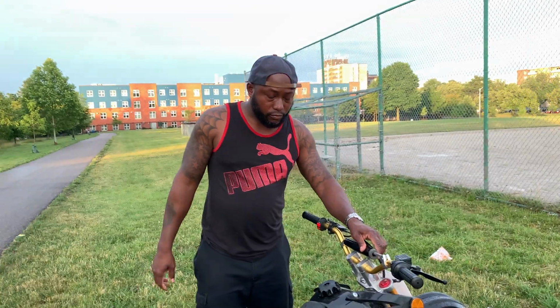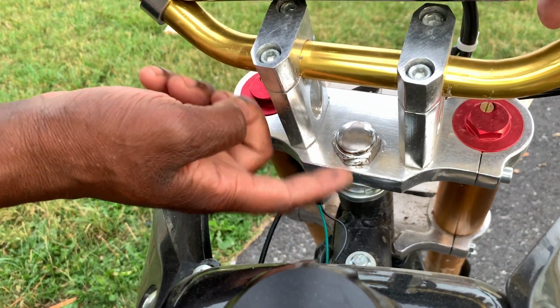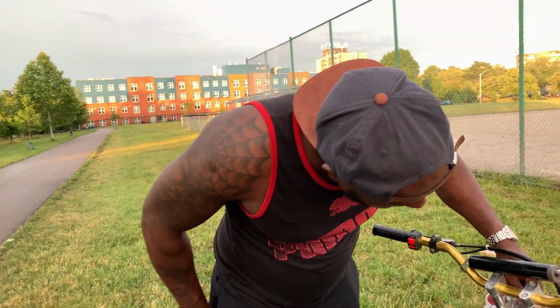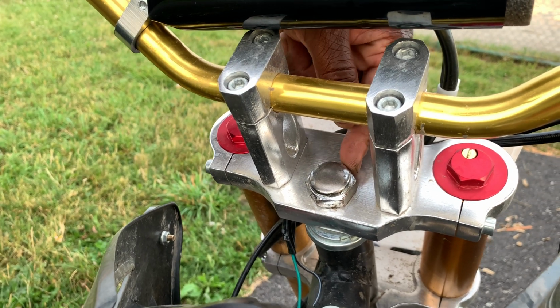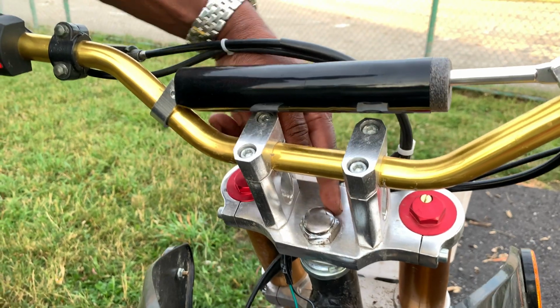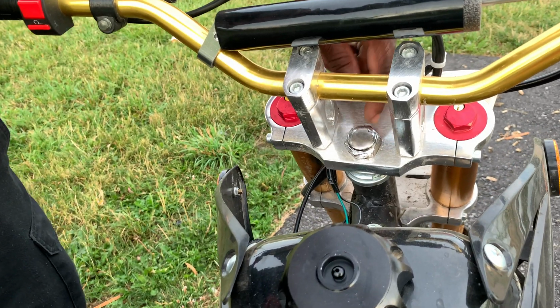So first, you have to put Loctite on this guy. You have to take this one off and put Loctite on that. If you watched my last video where I was in Hamilton recently, I went over there to do some work on one of my subscribers. They have two 150s, and as you can see, they already lost one of these on their bike because they were riding and didn't even realize it got loosened up, and it just dropped off. When I went over there, there were two bikes, but only one bike had this on it. So you want to take this off. You can use an adjustable, and you want to make sure you put Loctite on that. Loctite is a must on this one.